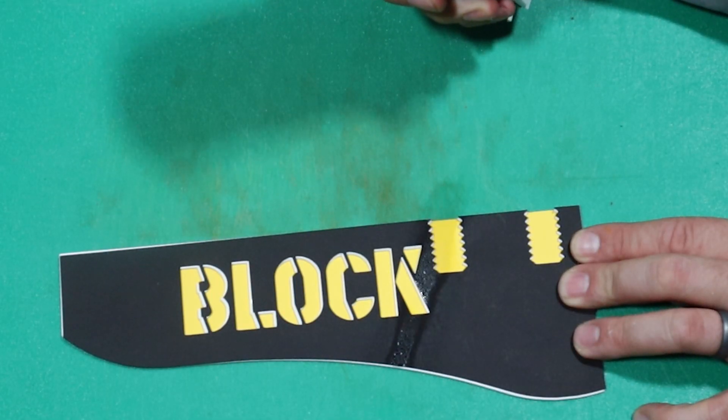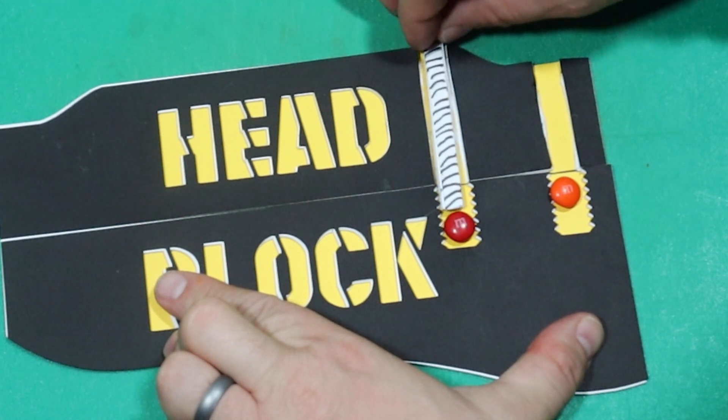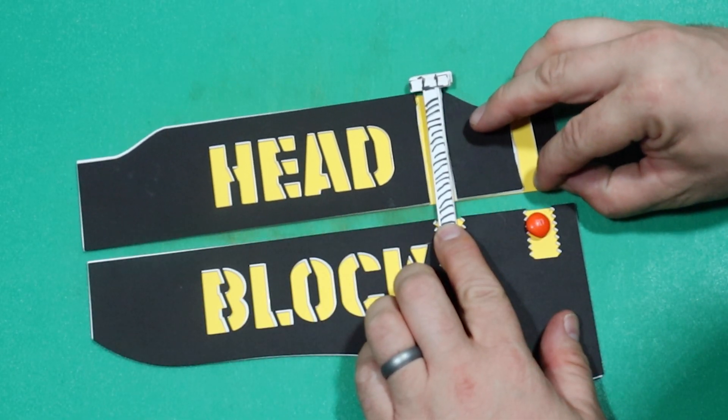Studs are also more forgiving for some of the challenges a DIYer might face when doing a head gasket replacement. Every source you find about doing a head gasket job will strongly emphasize how important it is to blow out the head bolt holes on the engine block and be certain there is no debris whatsoever in them before you put the head bolts back in. If there is enough debris at the bottom of one of these bolt holes, it will create a new floor which the bolt cannot pass through. If the bolt strikes this floor before it is fully torqued, it will at best provide insufficient clamping force and, at worst, could result in a stuck broken bolt and/or stripped out bolt hole.